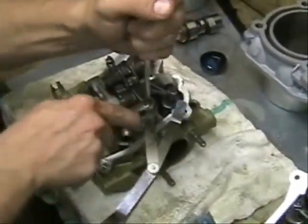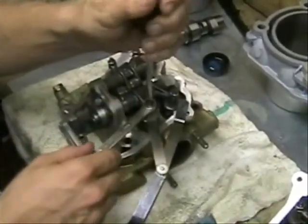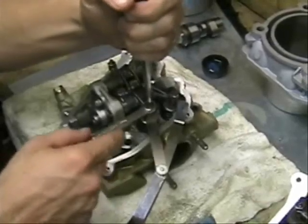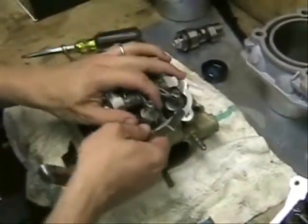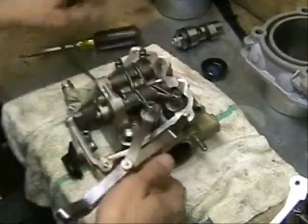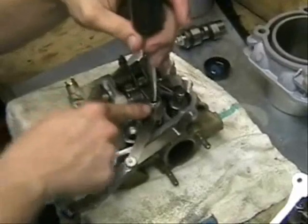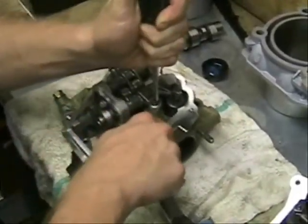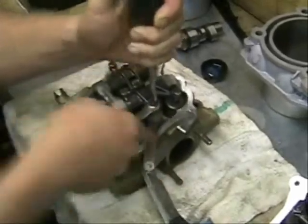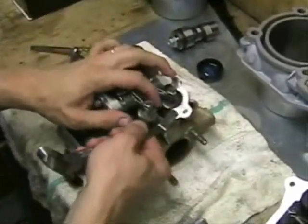We'll loosen our nut. We'll see where we're at with our screwdriver. We'll turn it a little bit and we'll tighten back down on our nut. We'll pull, that's way too tight on our 16 thousandths. We'll loosen her up again. And these are very small changes that we're doing.